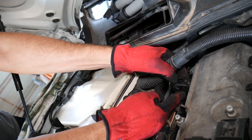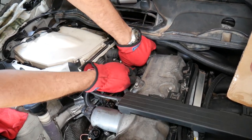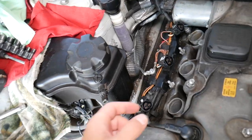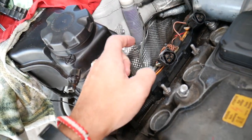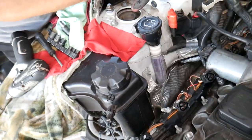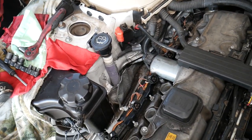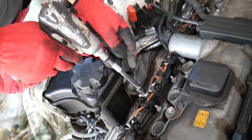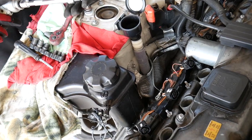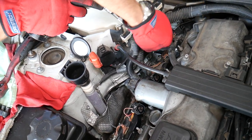Some coils haven't been removed since the engine was new. People don't always do as much maintenance as they should — check your spark plug gap, it can improve engine performance and fuel economy. Next, we need to remove the ground wires for the ignition coils using a reverse torx E10, 10 millimeter — there are two bolts. Make sure you reconnect your ground wires everywhere, otherwise your car may not even start.